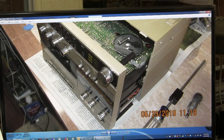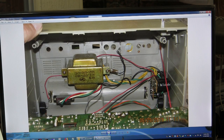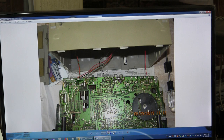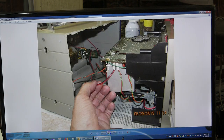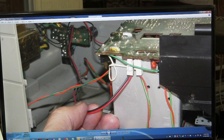The whole chassis just slides out after you open the back or take that off. You can never take enough pictures. Slide it out, take a picture of where the wires go just in case. Here I'm holding the power lead, and that power lead goes in the first one, not the second one. The second one's for the motor.